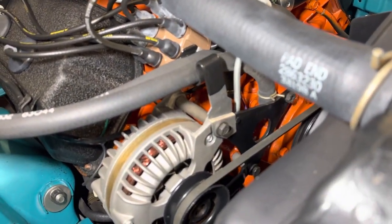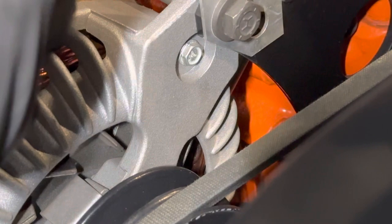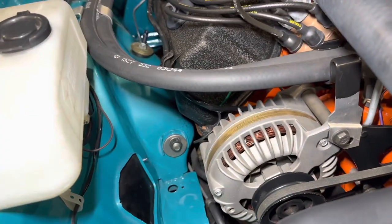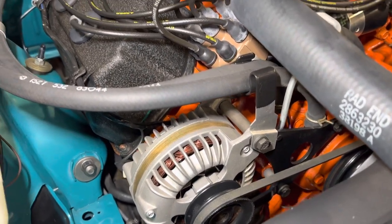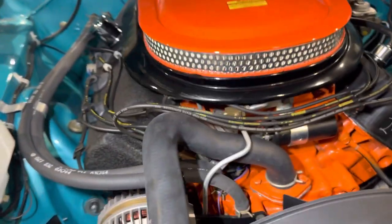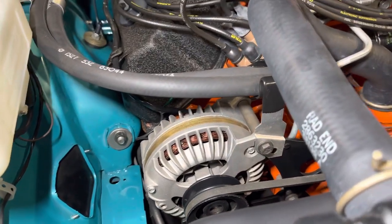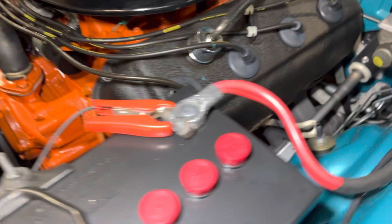There's one detail I want to point out — look at the alternator. Anytime you typically see that hole right there where that mating fastener is, that's a sign that it's been through a rebuilder. Often what happens is that fastener is froze up, so they end up having to countersink a hole in order to separate the two halves. This is where you need to reach out to Jim Ridge from Dixie Restorations. He can certainly assist you with the proper restoration of your alternator and starter. I can guarantee you that Jim Ridge does not do that to his alternators — they are professionals. If you haven't seen the video, you should go back into our archives and look at the video of Jim Ridge's alternators; it's well worth looking at.